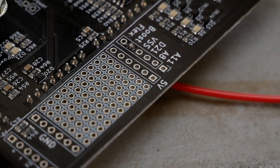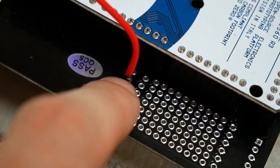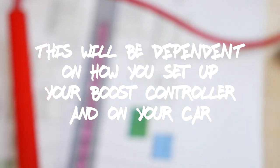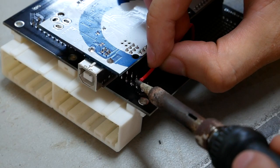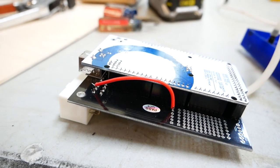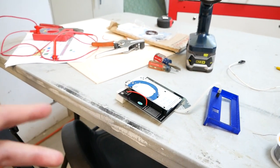I did go back on top of the board and just add a little bit more solder, and for someone who's not really too experienced with this stuff I'm pretty happy with that result. Here's the back of the board — we're going to run this wire from here over to that front pin there, which is the bottom pin one in from the side, which based on the wiring diagram is the one that we're going to be going to. Here is that jumper all in place. Now it's time to put this ECU back together, get it in the car and see if our solenoid fires. We need to set up the solenoid in the car before we can test that so I will jump to that right now.